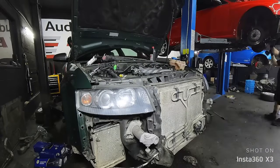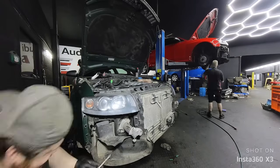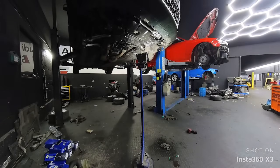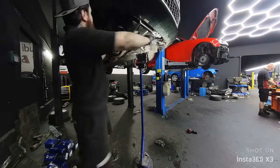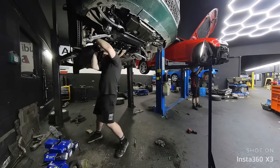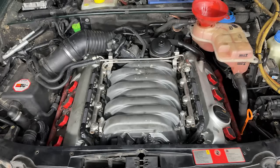I put the new rubber engine mount in the front, and after putting all the plastic trim and the front crash bar on, I can finally put the front bumper on. From underneath, there's quite a lot of things to put on — piping, hydraulics for the power steering, exhaust clamps, prop shafts, driveshafts. There's quite a lot of running around. We are finally finishing off, guys. Before we start the engine, we're just going to crank it to make sure we have oil pressure, and then we can start it up.